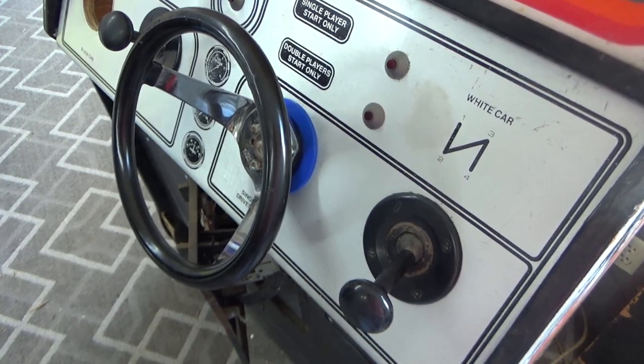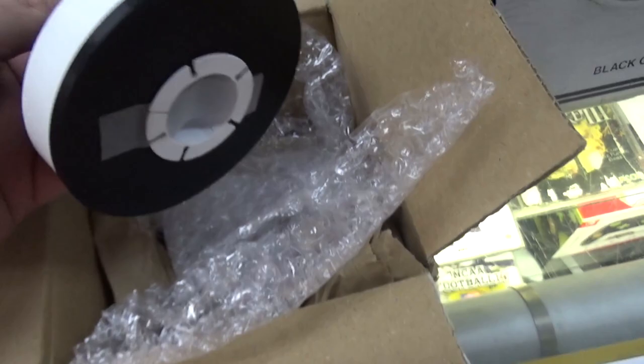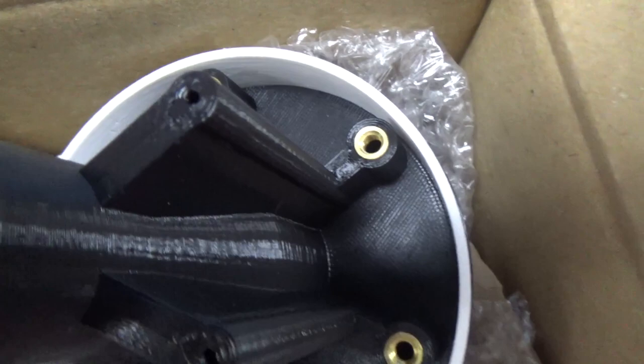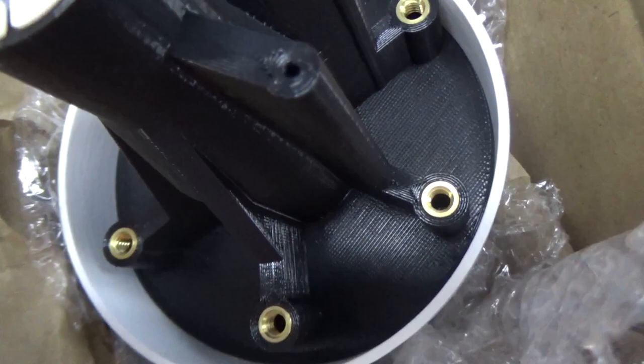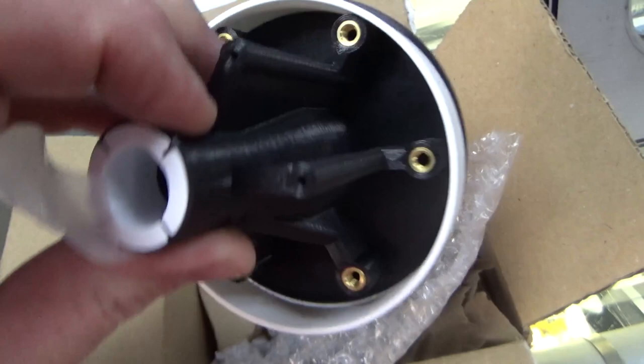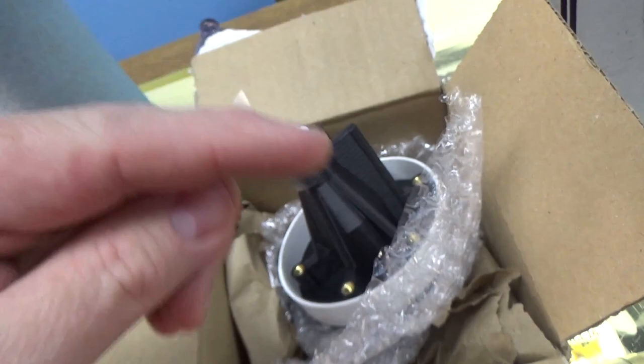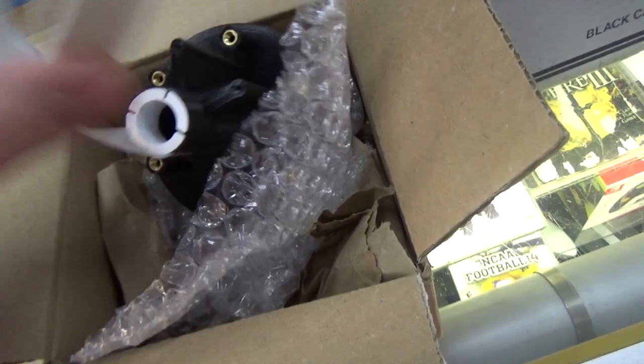Okay, folks, we have got, we believe, the next stage prototype. This may be the final product. So, differences: added plastic, metal studs, inserts. What do you call those? What are those called, Joe? He says they're called inserts. I can't remember the name of them, but there's a specific name for those. The purpose of that is, those shoulders are what usually break on the game because they use bolts that basically have a thread in it that just eat into the original stuff.